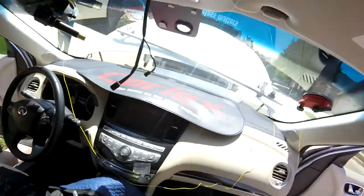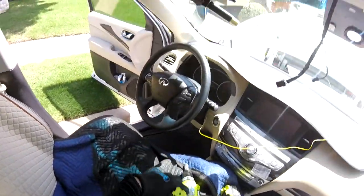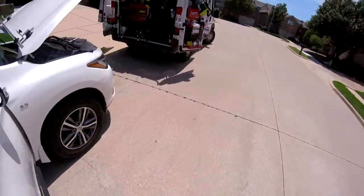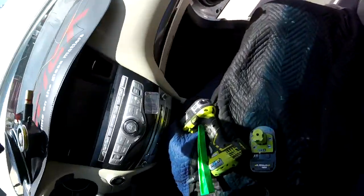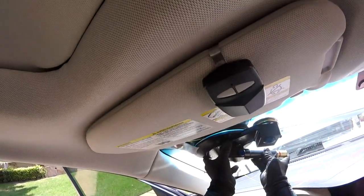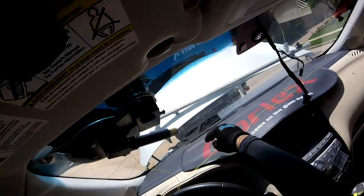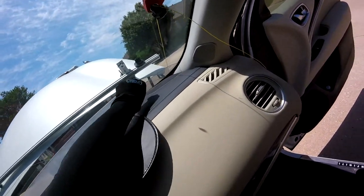For this video cut today, we have a 2016 Infiniti Q60. We're gonna replace the windshield. Today I'm not gonna make any cuts in the video — I want you guys to see the cuts in one continuous take. I'm gonna show you how to attach the new improvements for this glass. So first we're gonna attach on the driver's side. Remember this suction cup is more concave or more deep, so you have to first address the problem with the bead line. You have to set the tool like this and push the air out. Then you start pumping with the suction cups.